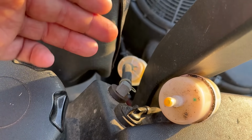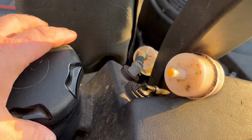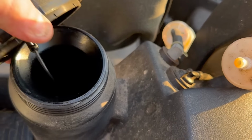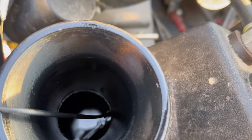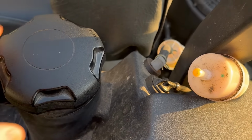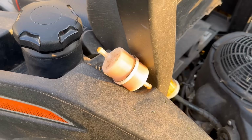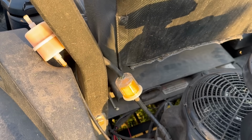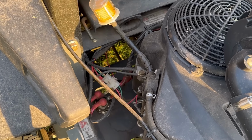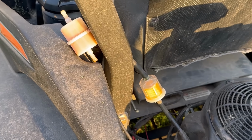It's just trickling out of this hose down onto the filter media. And the way that it's configured, we have a fuel inlet in the top of the tank instead of in the bottom. It's got a tube that runs all the way down to the bottom of the tank, which eliminates the siphoning effect and constant pressure on the system if it was on the bottom, gravity flow. But since this has a fuel pump, we should be good to go.